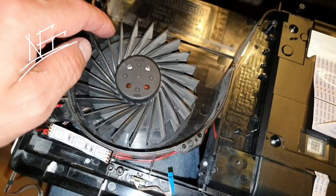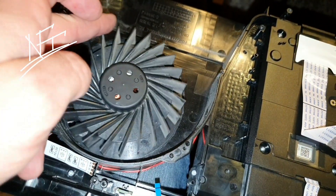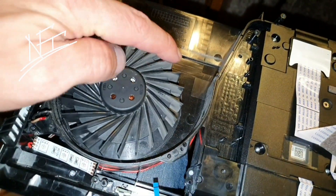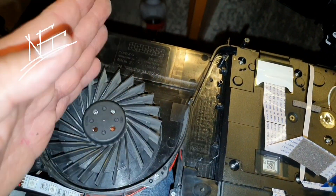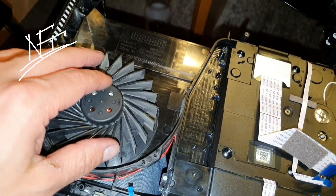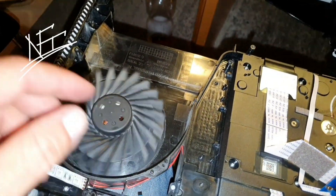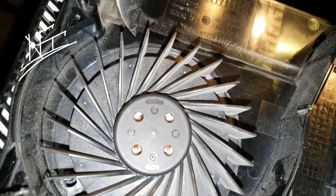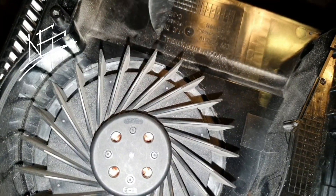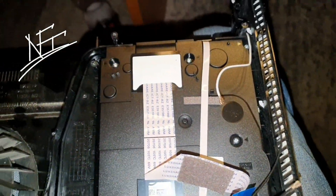You need to make sure the fan turns the correct direction. If it turns the wrong way it won't work — the fan needs to turn this way to blow air out correctly. You need to think about and calculate this beforehand. It sits perfectly; I just need to lap it a little bit more on the right side.